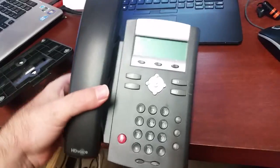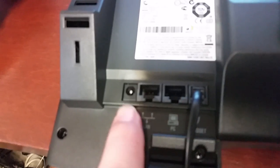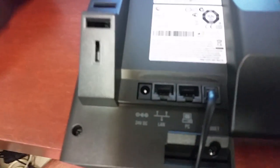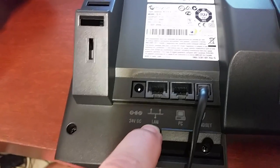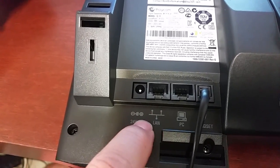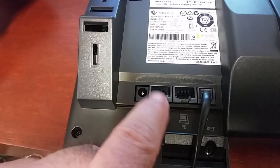What I'm talking about is this is like a Polycom SoundPoint 335. If I flip it over, you see right here there's two of those — what they might call RJ45 ports. The formal name is 8P8C. The reason there's two ports is because one comes from the wall or the network and goes into the spot marked LAN, L-A-N. Or if it doesn't say LAN, it might just have this little icon of a network, which is like the straight lines with little dots on them. That one is for the network.